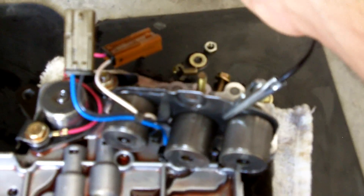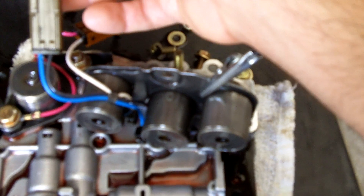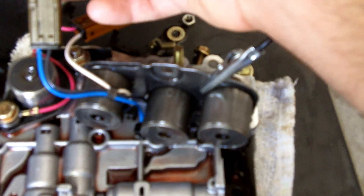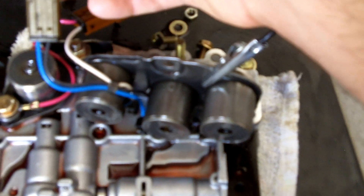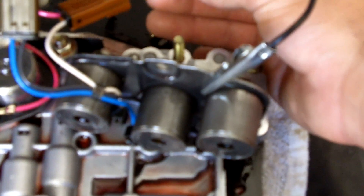We move the ground over to the other three and start testing. I get a little bit of sound when the test probe actually touches the lead, but that's more of just you hearing the arc of the current, not necessarily the solenoid. But nothing. And you hear it a little bit, but the sound's coming from up here, not down here. And the third one — nothing.